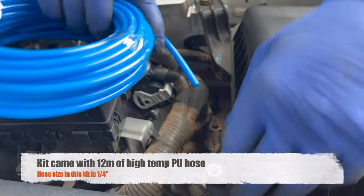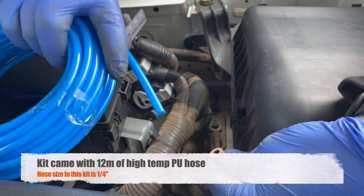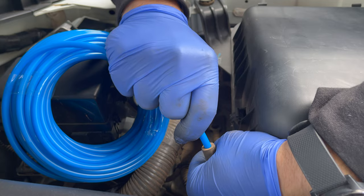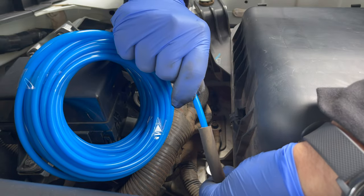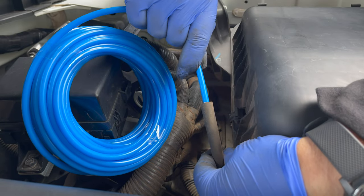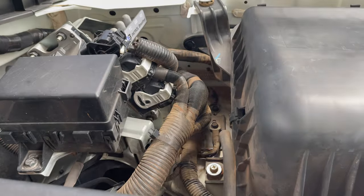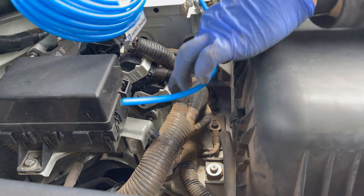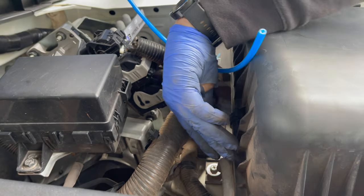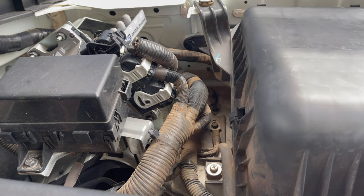The piping that comes with the kit is this plastic blue piping. This is the front diff breather — you can see it's actually quite a tight fit straight into the hose. If you really wanted to you could probably use some silicone in there, but that's definitely watertight enough for me. It's definitely touching the sides and it's going to be perfectly fine. I'm not going to need a massive run of this — try and keep it out the way. I might go right down low; this is naturally curved over like that, down towards the bottom. I'm just going to run probably about 30 centimetres of that.